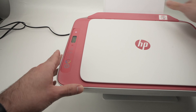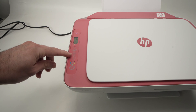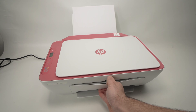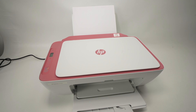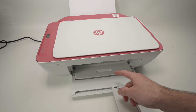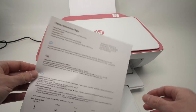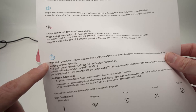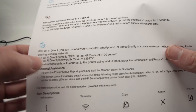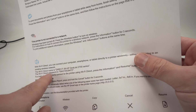To print the password, all you have to do is press the I button on the printer. The I button is located right under the Wi-Fi button. Press it once and wait. You can also extend this door over here because we don't want the paper to fly around. Usually in about 25 seconds we should get the paper. On the printed page you'll see the same logo — the smartphone and printer — and then the Wi-Fi network name of your printer and under it the Wi-Fi Direct password, which is a series of numbers.